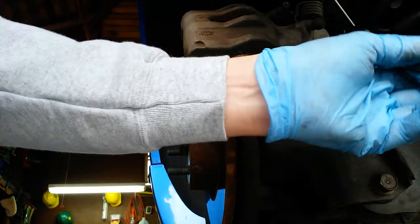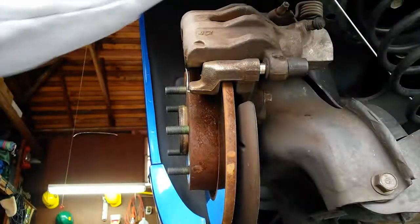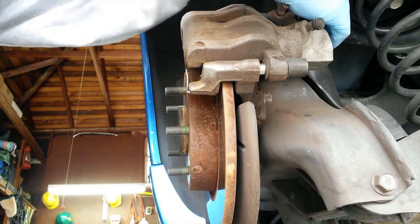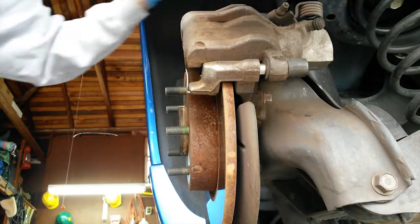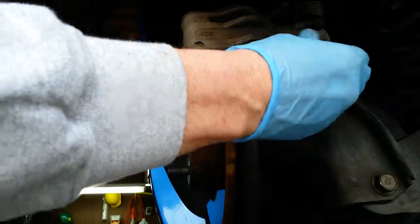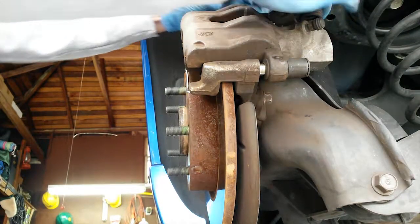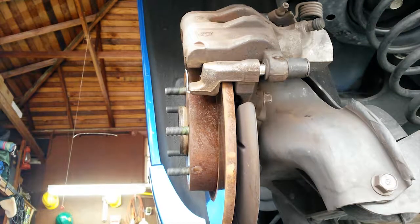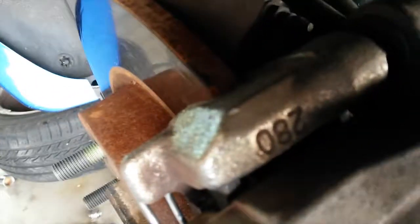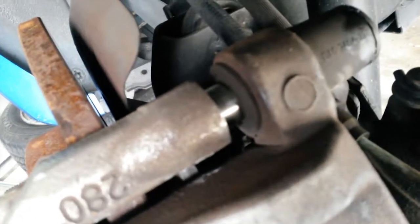Now I take my torque wrench, it's 21 pounds, and it's pretty quick. Again, I had just barely hand tightened these, so 21 pounds is not a lot of torque, but that's what the specs call for, so we go with the specs. The last thing we do is put on the dust covers, make sure you get both of them in place. And you'll notice that there is a gap, and that is normal. The difference is that now it's a shiny gap because you've cleaned up that pin. But that's normal look for the calipers